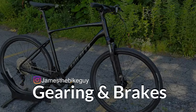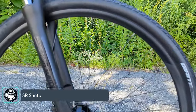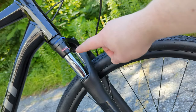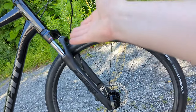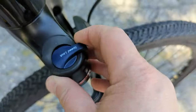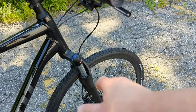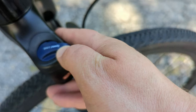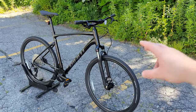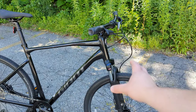Moving into the parts and components, let's talk about the suspension fork. Up front we've got an SR Suntour NEX fork with 63 millimeters of suspension travel, meaning the front end can compress 63 millimeters to absorb bumps as you ride through. One neat feature on this fork is the speed lock — an adjustable lockout where you can go from fully locked out so the fork can't compress, to fully open for maximum cushion. If you're pedaling up a steep incline and don't want the front end bouncing, you can lock it out and open it up when you need extra cushion.